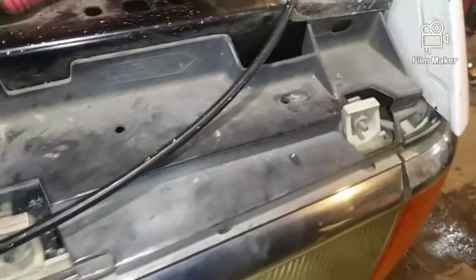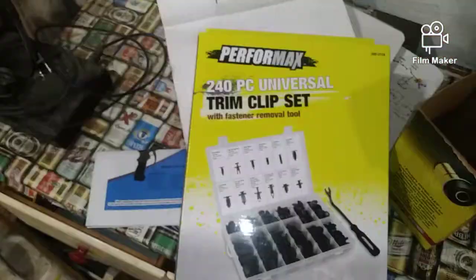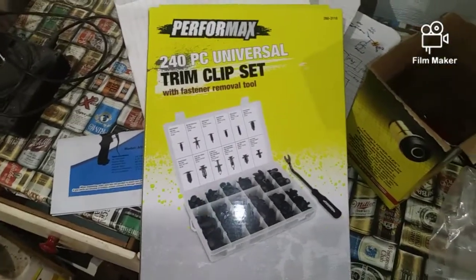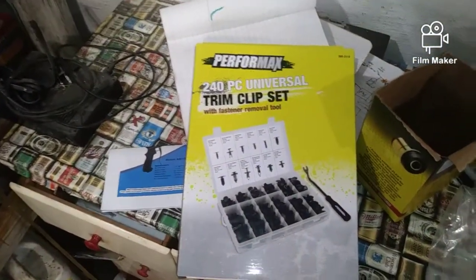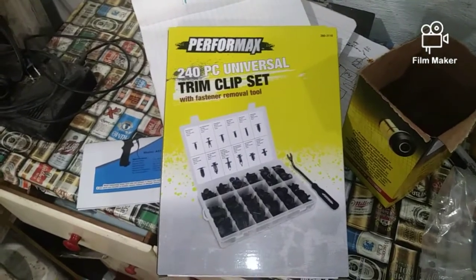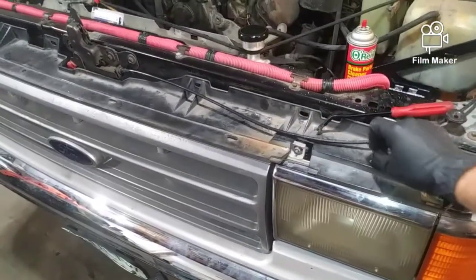Just like that — you can pop them all the way out. Some are like that, they don't all go that way. What you want to do is pop off this whole entire plastic piece up here. Yours should look very similar. Pop off this whole piece, point by point. It does help if you invest in a kit similar to this variety set — keeps one on hand, especially if you're doing DIY. These things break and pop all the time on cars. You might also have to pop off a cable or snip a wire tie holding it in place.